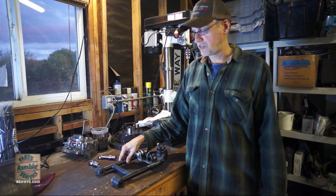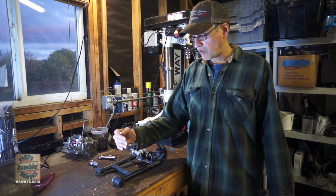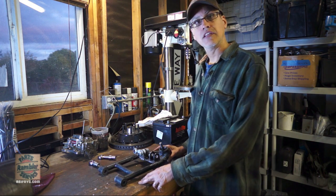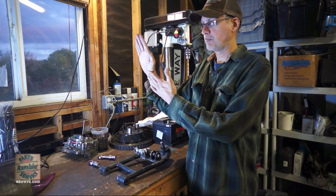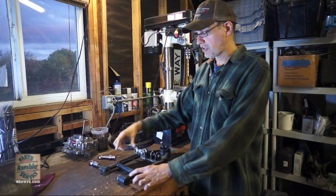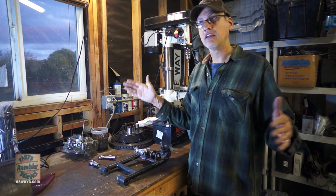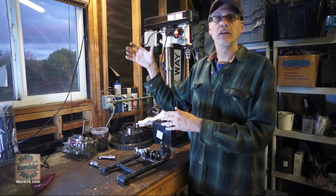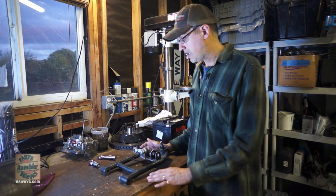So I started looking at the lower control arm. It's not adjustable as it comes from Control Freak, but I thought: what if I cut the ends off and put rod ends in, and use that to lengthen the lower control arm? Lengthening the lower control arm has the same effect — it kicks the bottom of the tire out, kicks the top of the tire in, and gives me negative camber. At the same time, depending on how much adjustment I give myself, I can increase the front track of the car and even push the upper control arm out for more clearance around the coilover, and still get the negative camber I want.